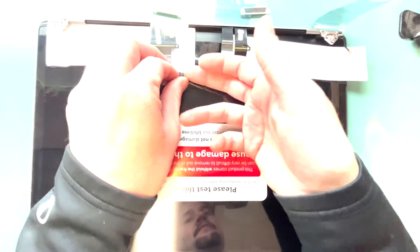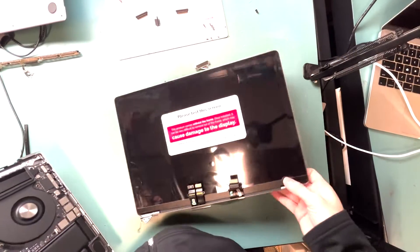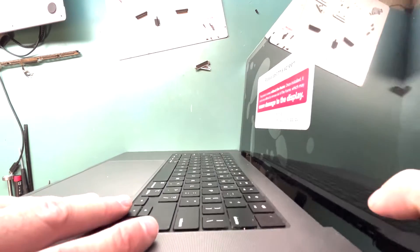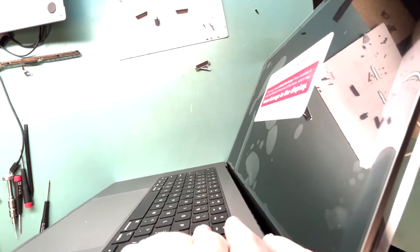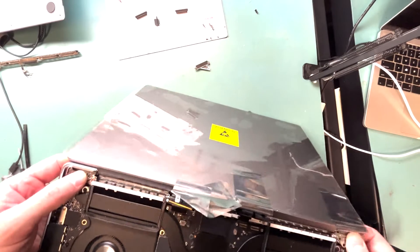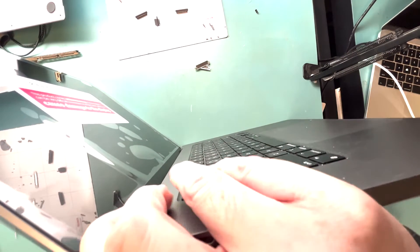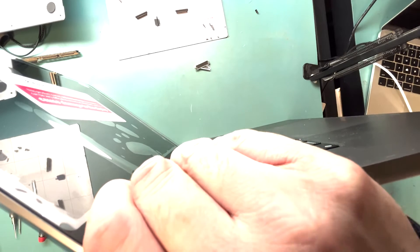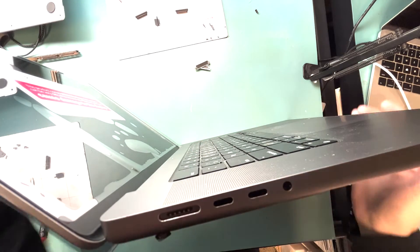With the screen prepped and hinges pulled back, pick it up and position it just as it was when we unscrewed it. Lay it flat — use gravity to pull it down, you'll hear it click in. Make sure you don't have any slack in the ribbon cable or get it snagged in between, or you won't have enough reach to connect it. Then put it back on its side, grab your T8 screwdriver, and screw in just one screw on each side of the hinge, then test the screen.